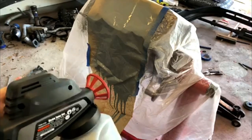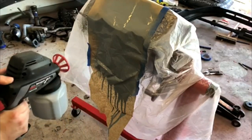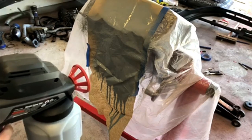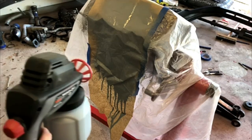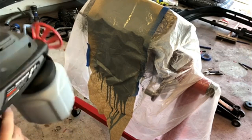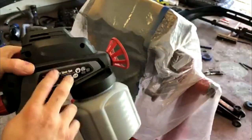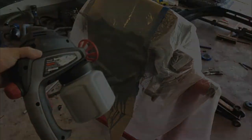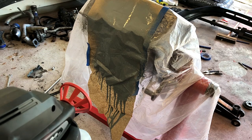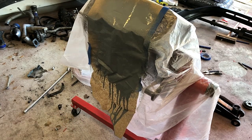It's having a little bit of a spraying issue. I think it's because the paint's a little too thick, so we might need to add a little acetone. It's basically spraying it out like a squirt bottle with the stream setting. I've adjusted all the settings and it's not doing it, so I'm going to have to take it apart and clean it real quick. It turns out it was just really low on paint — that could be why it was sputtering. I added a little acetone and that was the issue. So make sure that it has plenty of paint.